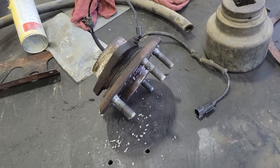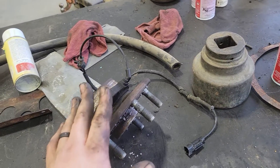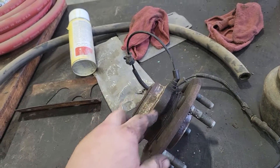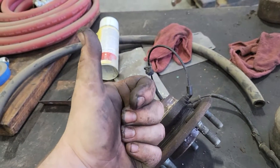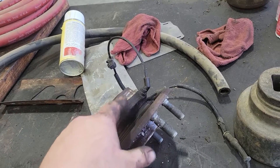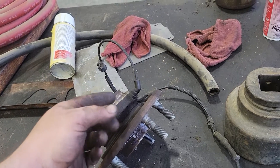So let's say you're driving to work one day and your ABS light comes on. Normally that's not going to happen, but if you have an ABS light on with a code for air gap, wheel speed dropout, or fluctuating wheel speed — check your wheel bearings. This applies to cars with rear wheel bearings and front wheel bearings on CV axle cars.